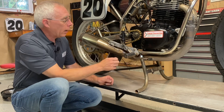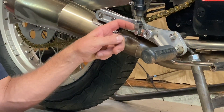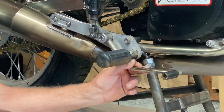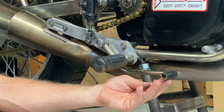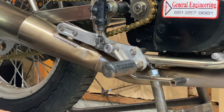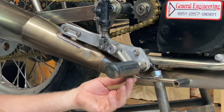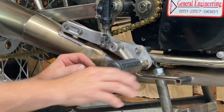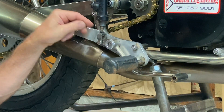So if we want to adjust this pedal down, what we would do is loosen this jam nut and thread this push rod further down into this clevis. What we don't want to do is put something over here that limits where the pedal goes — how far it can return. The way Mike has this set up is good, in that even if you push it up, it's not being limited by this foot peg. I've seen many times at the track, even at top level professional races, where they make an adjustment and either the foot peg is in the way, or an exhaust header or something like that, and there's a preload held keeping this partially stroked. Always got to make sure that this master cylinder is returning all the way.